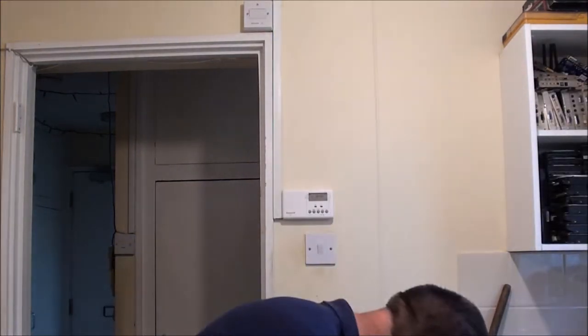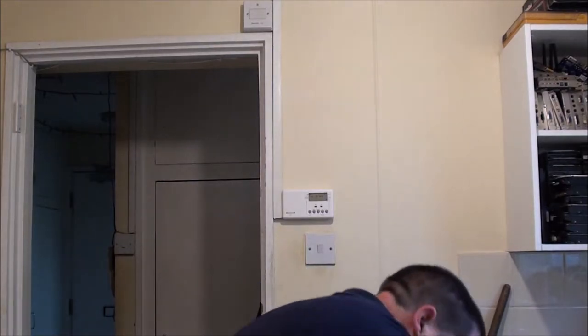The games consoles I bought off my brother, they all work. In fact, two of the PS1s needed some very slight attention. One of them had a sticking eject button and the other one, the laser reader that runs back and forth on the runners to read your CD, stuck. Literally just a very small squirt, because it's all I have, of this 3-in-1 bike oil, a very tiny squirt on each runner got that working, and a tiny squirt on the eject button stopped that from sticking.